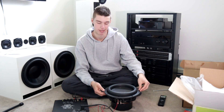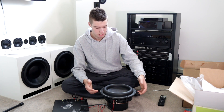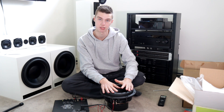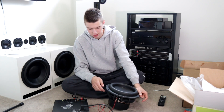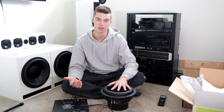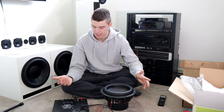Free air even — obviously sitting like this there's a fair amount of mechanical noise. Turn it on its side so those ports on the bottom are completely open, and the sub becomes silent. I'm not pushing this thing to its limits, so I don't know the limits of the amp or the sub just yet, purely because it's only just brand new and hasn't been broken in yet. Basically the surround and the spiders will still be very, very stiff. Forcing them to work extremely hard when they are very stiff could possibly strain the glues and things like that, possibly risking premature wear and damage.